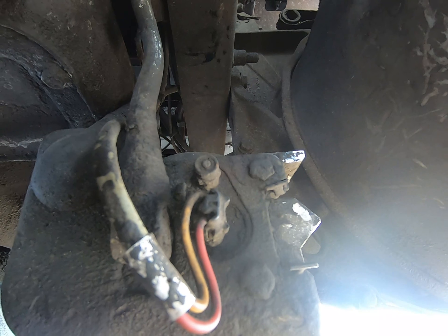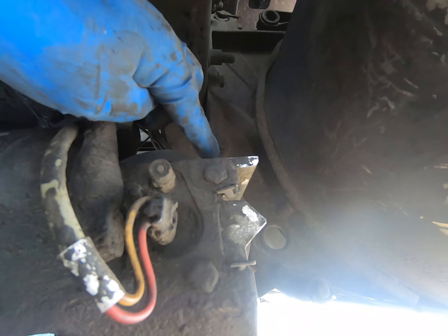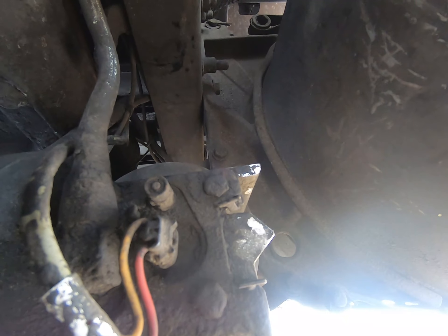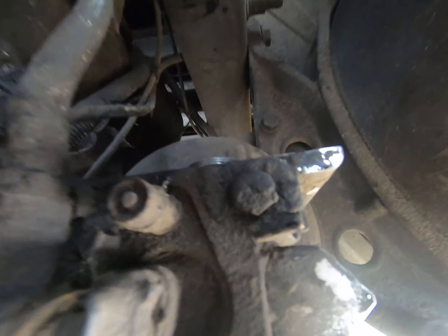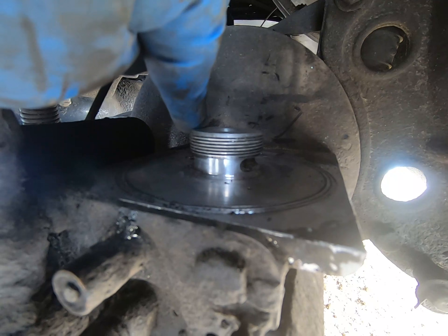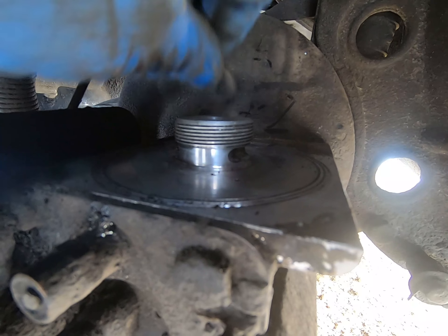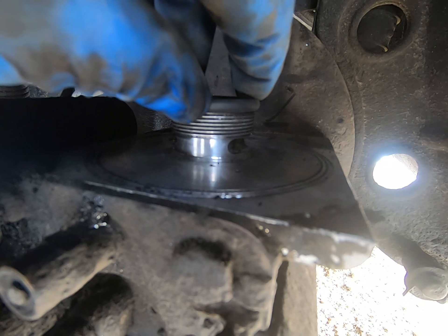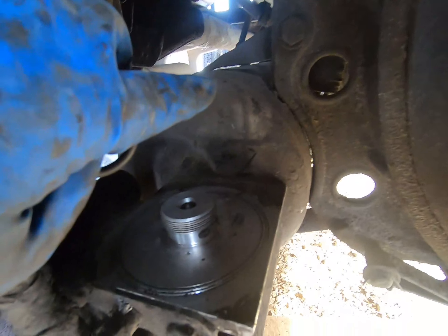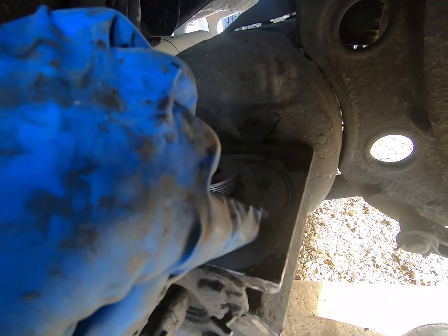Let's look in there — we got moisture in there, definitely. There's actually a little piece of ice in there, and it's crunchy and a little sludgy, but only a tiny bit of oil — mostly water. It's cold outside so a little icy, but it definitely needed to be changed. Take your finger and check around in there to make sure the gasket came off with the old one — you don't want to double-gasket it. Clean up in there, even use a little brake cleaner if needed. You can see the stud that the cartridge screws onto, and there's a little o-ring that came with it — it goes down over the stud and we'll lubricate it just a little bit. The outer o-ring seals across the outer part, so clean that up real nice.